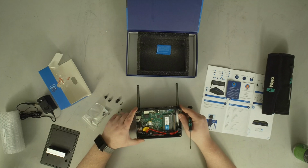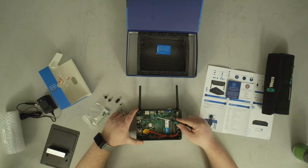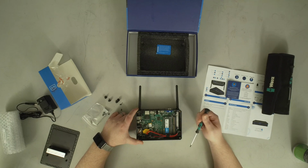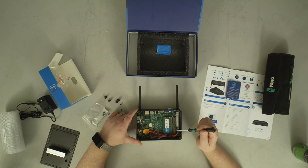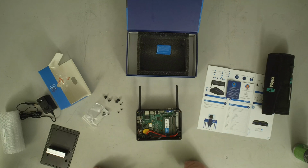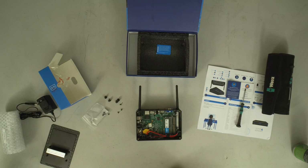And that's to say nothing of M2 SSDs, they don't use no power, but they do use some power. You could get 2.5, 5 watts out of an SSD. Same thing for a SATA drive. So if I attach a big 10 watt USB-C device to this and I upgrade it internally as far as it'll go, I might run into a limit with that 2 amp brick. So we're going to attach it to, I've got a 4 amp adapter in our testing.